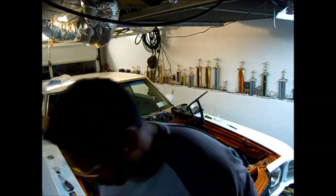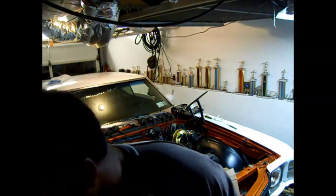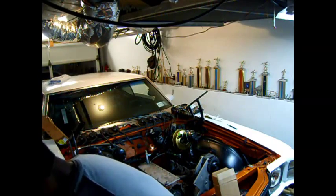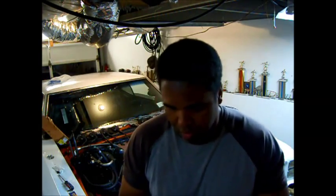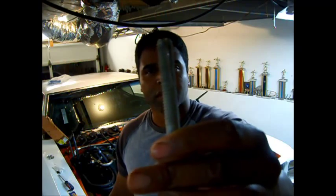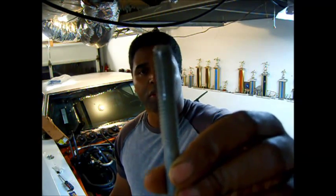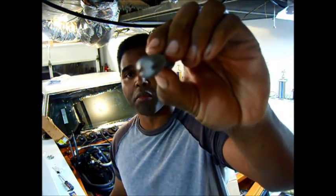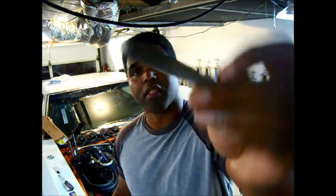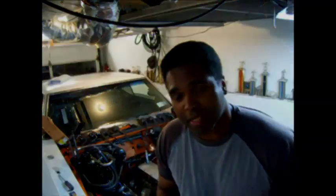Now I'm going to get my goggles because safety first. You see how I made grooves in the side of the bolt — only two grooves in the side where it looks just like this. This pretty much simulates the same idea as a chaser, and at a fraction — cost of nothing. I'll show you exactly how it works.